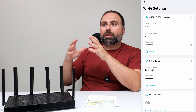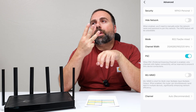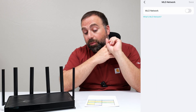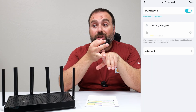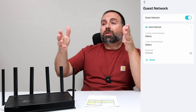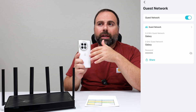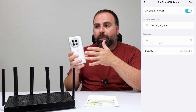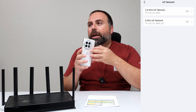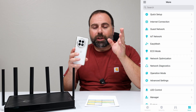The fourth tab is essentially the main settings tab where you can set or change your Wi-Fi names. You get three main Wi-Fi names: the 2.4 GHz and 5 GHz combined, a separate 6 GHz band you can enable — which is what I used for all my testing — and an MLO (multi-link operation) option. MLO is a Wi-Fi 7 feature that allows a compatible device like the OnePlus 13 to connect to more than one band simultaneously to improve speeds. However, in my testing, connecting to just the 6 GHz band generally gets me just as fast speeds, if not faster, so I don't really enable MLO for single routers anymore.